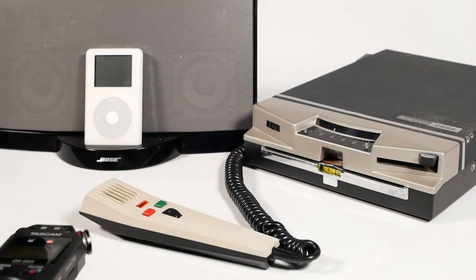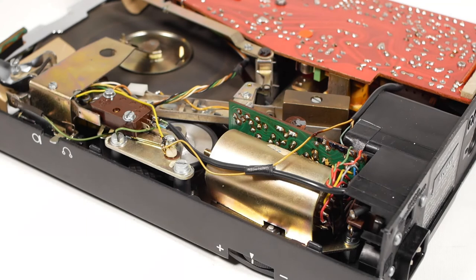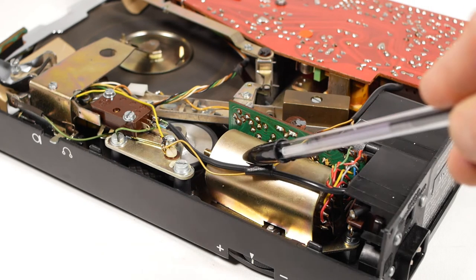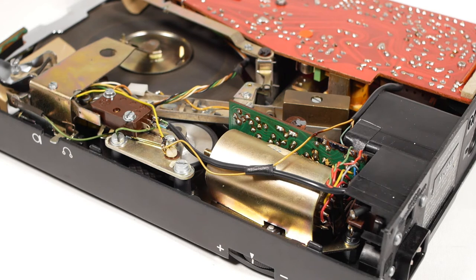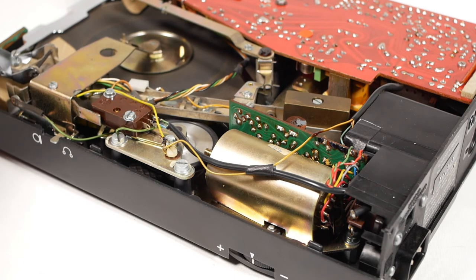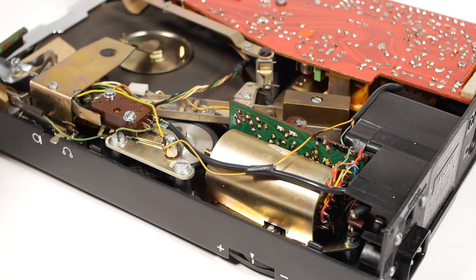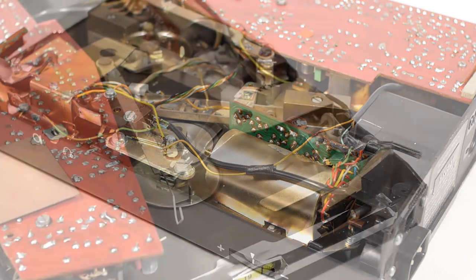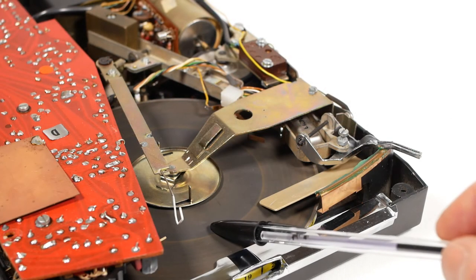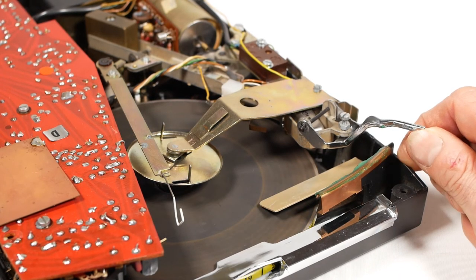Next up, I'll pop the covers off so we can take a look at the mechanism inside. Inside the machine on the right-hand side, we have the mains transformer here, with the mains input socket here. The drive motor is this cylindrical object, which will be spinning the entire time the machine is turned on with the head lowered. There's a micro switch here which cuts the power to the motor when the head is locked out of the way to insert or remove a disc. Then as soon as you lower the head, the metal tab presses the micro switch. You've got the platen that the disc sits on here, and when the head is locked out of the way this central hub is raised, allowing you to insert the disc, like this.